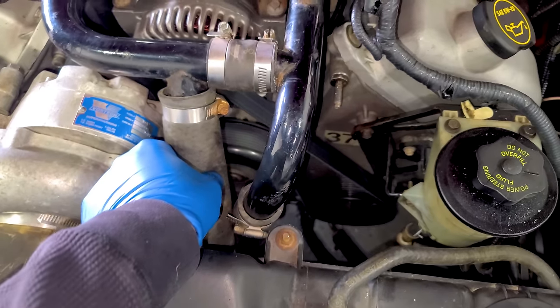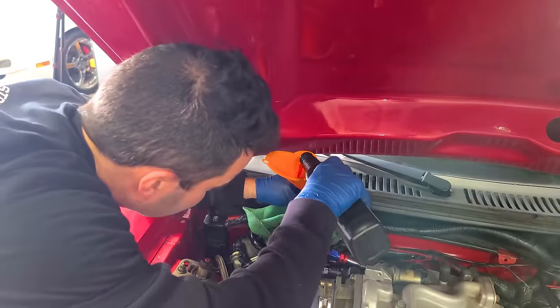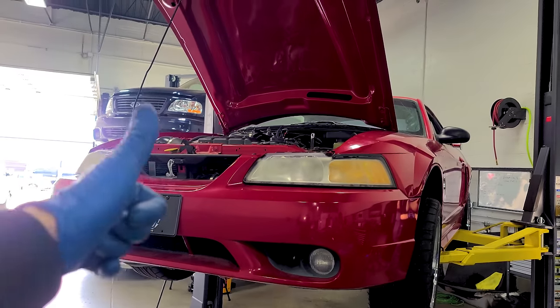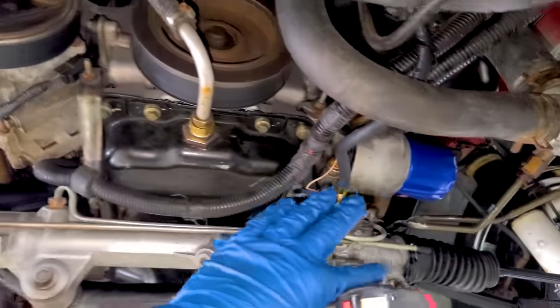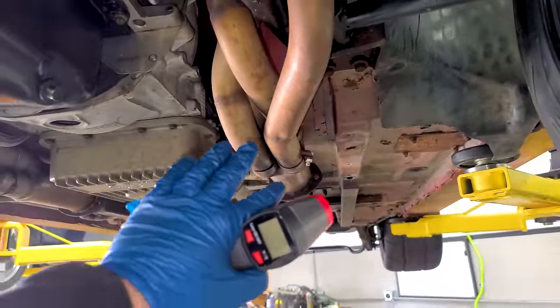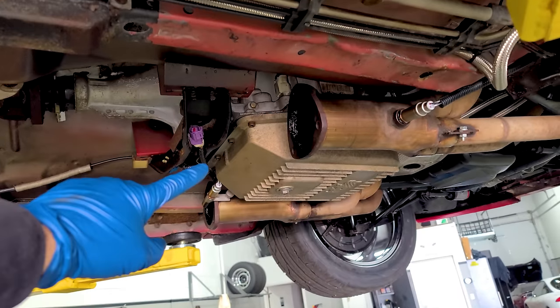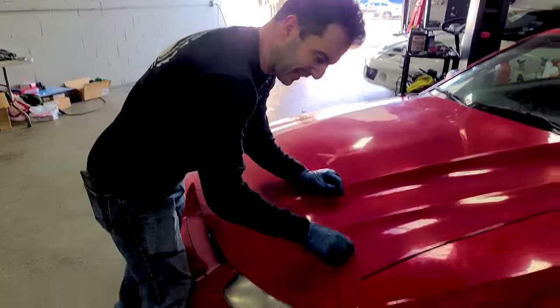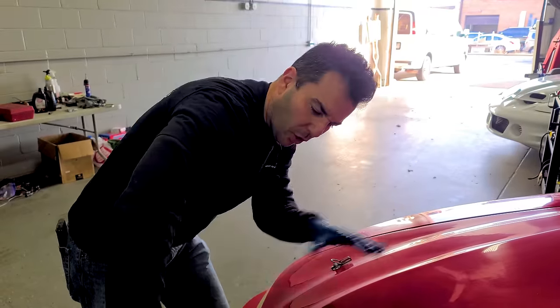Filling the transmission is horrible — we have this really tiny fill hole and we can't spill it everywhere. We're good on transmission fluid level. Laser gun check shows no leaks; the new oil line is doing good. With open headers it's very loud. It's got about 10 inches of vacuum. The temperature checks look good across all primaries. And I forgot — this thing has a hood fence. Race car. I know why they did it — the intercooler system — but it works, even if I'm not a fan.